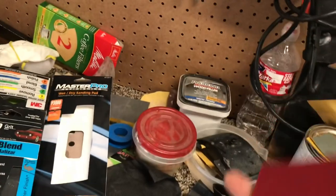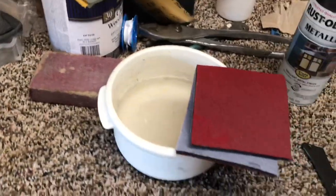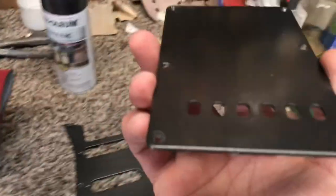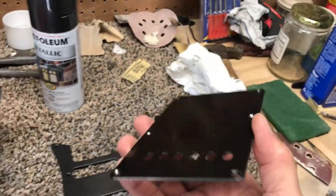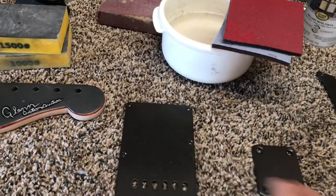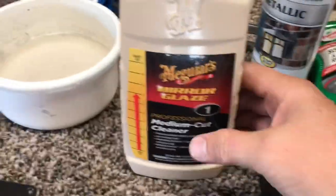You wet it down as well. It's like a sponge — a fabric-y material. I'm showing it right here. You just wet that down and kind of wring it out, and that would be the final sanding step. It's hard to find really fine grit sandpaper in stores, and I go to every auto store I can find. That 3000 grit was the highest I could find off the shelf, but it works really good. I don't see why you would need anything more than 3000.